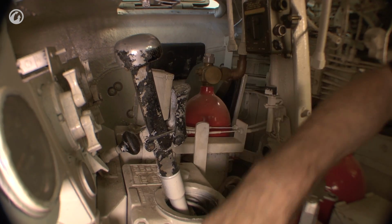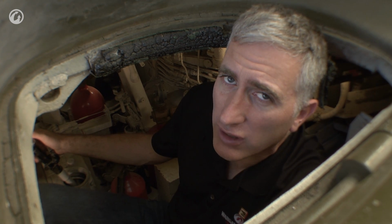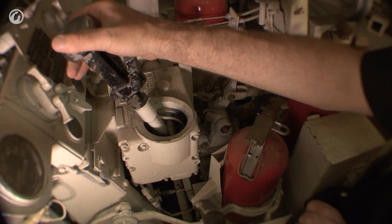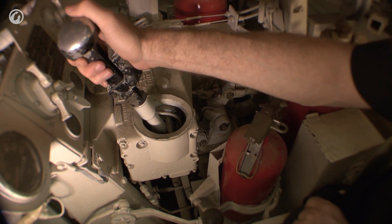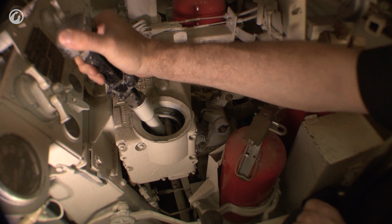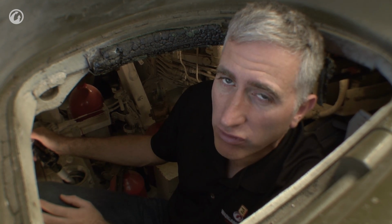Think of it as a side stick controller, maybe a bit like an F-16. By moving it forwards and backwards, it controls the gear. So all the way forward is neutral. You cannot move the stick to the left or right in neutral unless you push in on the palm switch, at which point you can then move left or right. In neutral, the vehicle will, oddly enough, neutral steer.